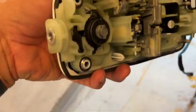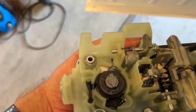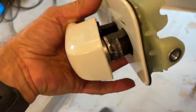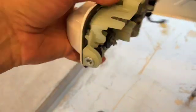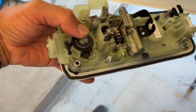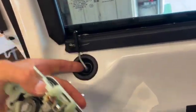I'm sorry, I don't remember how I dismantled the lock whenever I was there. There's other YouTube videos on how to take that out. I think there's just a clip holding on a rod. Like I said, whenever they twisted my lock cylinder, it broke these tabs down inside of here, broke my handle out, and so I disconnected this rod so that I could lock the door, because it was forced up where it wouldn't lock. So I got into the door, dismantled it.